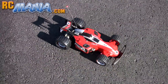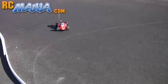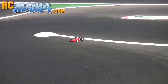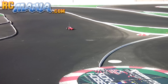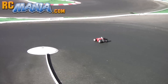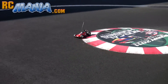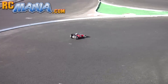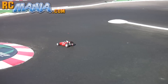Because the car comes with extra tires, I swapped to the large rear tires, keeping the two fronts in their normal configuration. With the bigger rear tires the car is noticeably faster, because the larger diameter effectively gives you a faster gear ratio. However, the larger tires aren't just better in every way — the car has a tendency to spin out a little bit in turns at full speed. So it's not as stable and not as good for courses with lots of turns; it's better for long straightaways going point to point.